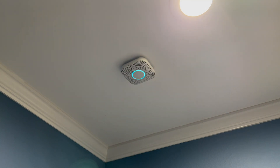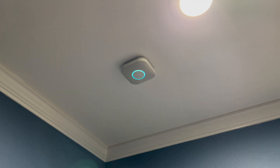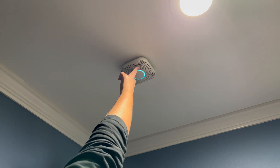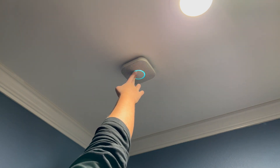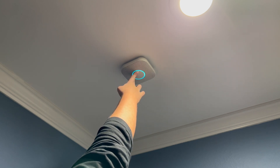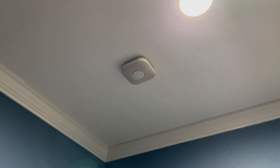The way to do a reboot is super easy. All you do is hold the button. The Nest Protect is going to say 'Checking the network, just a moment,' but you want to keep holding it. I'm going to keep holding it and let you know when to let go. When the light turns off like that, let it go — and it's going to go ahead and do the reboot.